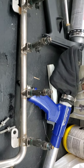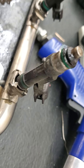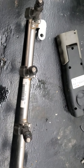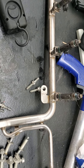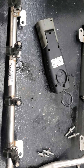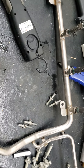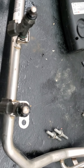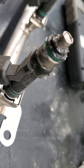You can't get too carried away with how much silicone you use. Even if you get some on the tips and nozzles of the injectors, silicone lubricant is fuel-soluble, so it'll literally dissolve as it starts firing the injectors. Don't worry about it — you can be as generous as you want. It might misfire a couple of times and it'll clear right up.